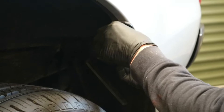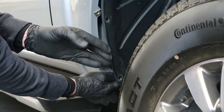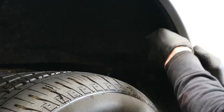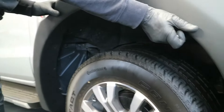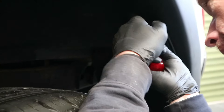For the rear arch we only need to remove the top push pin of the mud flap, but we then need to remove all of the push pins on the front of the arch lining. Apply the spire speed nuts in replacement of the push pins as done before. Clean the arch as done before. Then slide the wide arch kit into position and secure it with one of the screws provided. Remember the rear of the arch kit sits behind the mud flap.